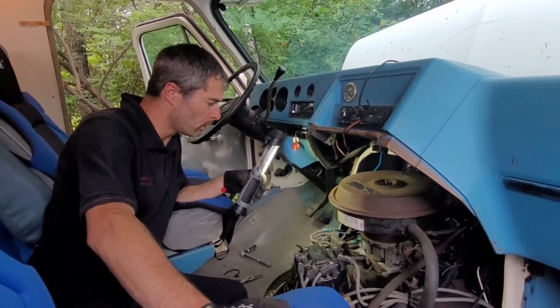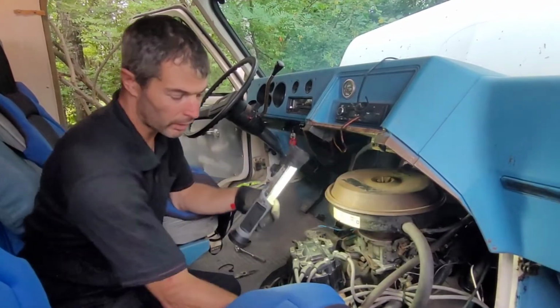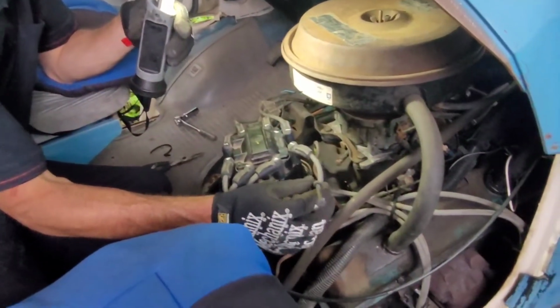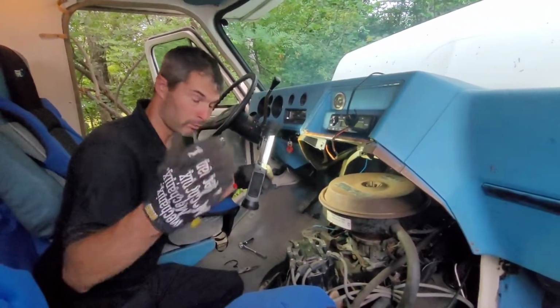Alright, so as you saw there, and by the way guys, before I started any of that, I made sure that my vacuum advance was disconnected and plugged off, so I wasn't getting any vacuum leaks, and I wasn't getting any timing advance.